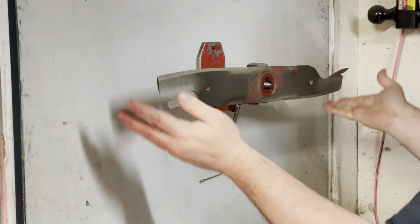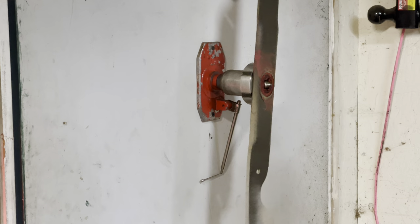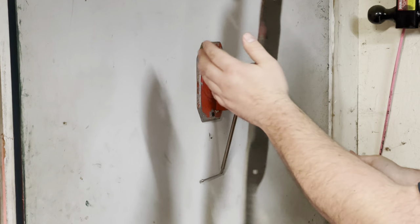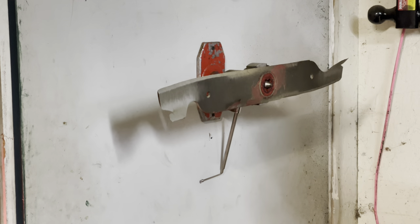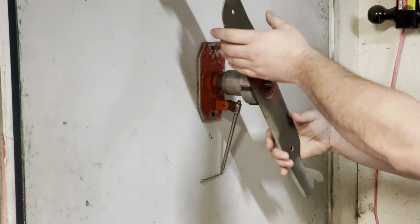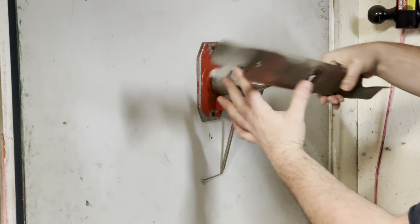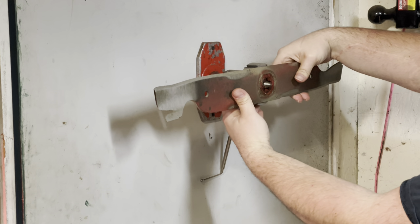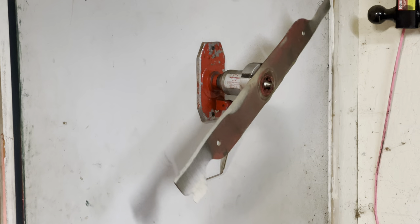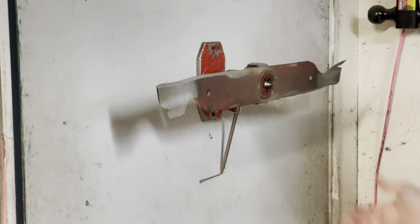It's got a nice powerful magnet on it. And it tells you right there — this side is definitely heavier. These are worn out blades, you can see they're missing a lot of metal. This is all just for demonstration purposes. Here's the second blade — put that on, slide the magnet forward. And again, the faster it swings down, the more out of balance you can see it is.